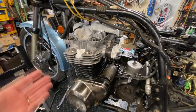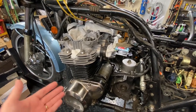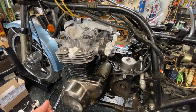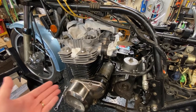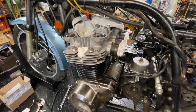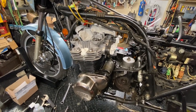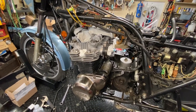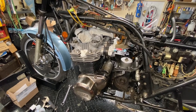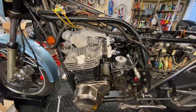So what I'm thinking is that under the compression shot, the actual velocity of the compression stroke, it is bypassing the compression rings, at least on one and two, in particular number one more than the other, or the other two that are low, I should say. If you understand what I'm saying, when you have that rapid squish, it's just bypassing a little bit. Because I honestly cannot find a smoking gun.